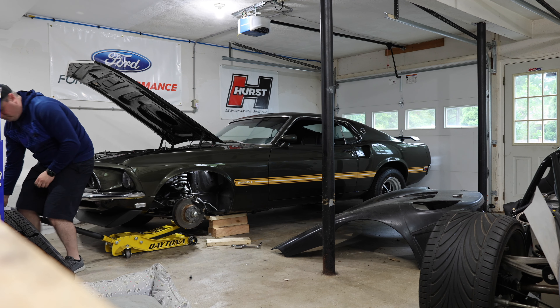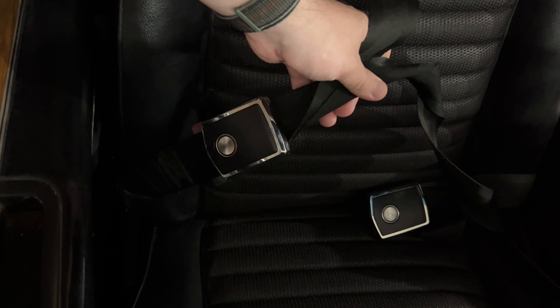On our inspections here they check suspension, make sure there's no smoke coming out of the exhaust, check all your lights, and check your seatbelts. I usually go through that checklist from the suspension all the way to the lights to make sure everything's working. It's much easier to get a fix beforehand versus getting a rejection sticker, needing to fix it, then come back 60 days later.